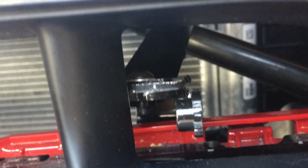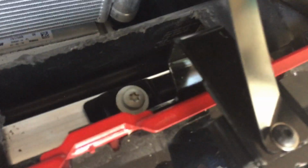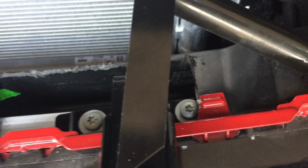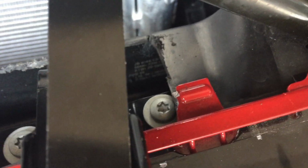I don't know, but in the future, maybe don't use Mini's exact measurements, because if I would have slid that bracket to the inside like 2 centimeters, maybe 20 millimeters, it would have cleared that, and I wouldn't have to cut anything. So the measurement that we did here for these bolts was 140 millimeters from the end of that piece. I measured over 140 millimeters. Now the book does say do it at 128 millimeters, and that's probably why they do that, because I actually moved it out a little bit, because I was cutting too close, or the screw was too close to the cutout. So I probably should have actually widened that cutout just a little bit more, and actually used the Mini measurement of 128, and I bet you it would have cleared this guy just right.